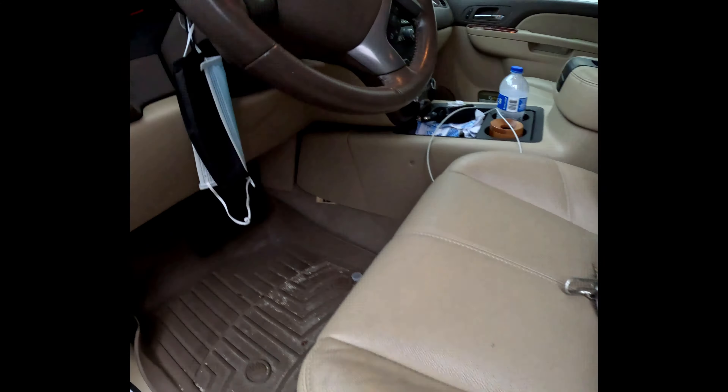All right, we're basically at 14.5 volts, which means the alternator is working fine. Now I'm going to turn it off. I've turned it off. The hose is warm. And you can see the battery has jumped down to 12.46.